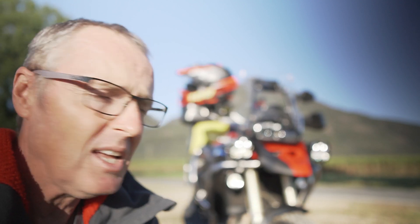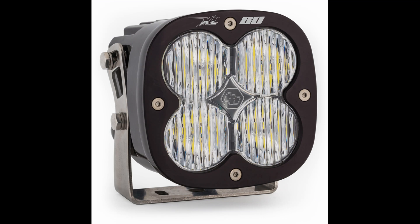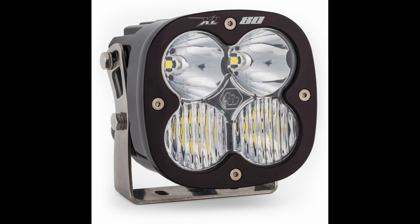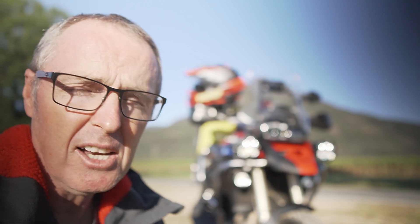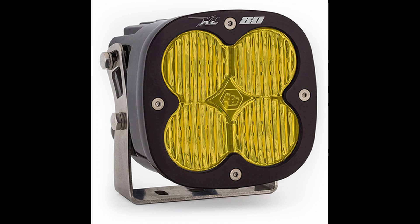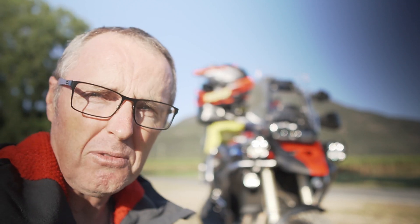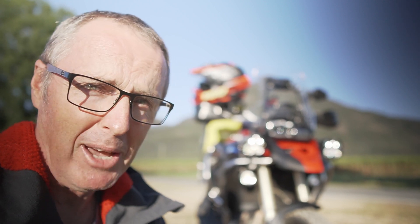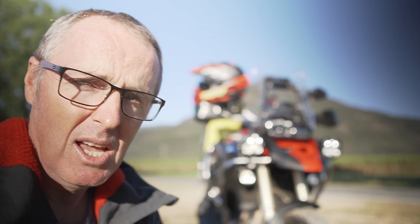The front is interchangeable — you can change the lenses so you can get a full spread. These are a combo: the top half of the lenses are clear and the bottom half have a spread lens, so they're the driving combo. You can also get a spot or the full spread. They're easy to change the lens — just four Allen screws and you can pop that front cover off, change the lens, and there's a rubber seal in there. Chuck it back on and they're good to go. They say they can be water blasted, and I have actually water blasted these to get bugs and mud off them — nothing's leaked into them so far.